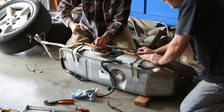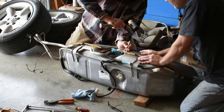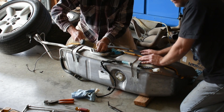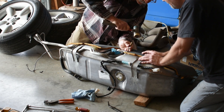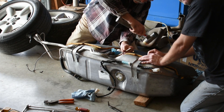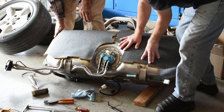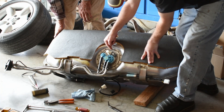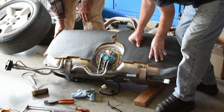So we got the hoses on. It has got a lock ring, just like on the front here — it slides in and tapers, so as you tap it around it will put tension against both sides of the gasket and seal. He is slowly working around to hit each side to get equal pressure all the way around. You want to drive these in all the way until the push tab hits the stop tab. These are the plastic components we are talking about so you want to be careful with those. You want to get your tapping touching your stop at several points. Get those all touching so you know you have got a good tight seal.